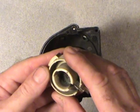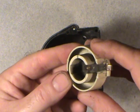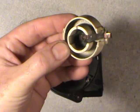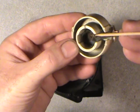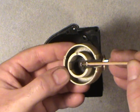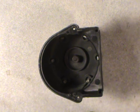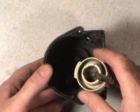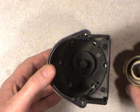It can actually get worn right through. This one went a bit too far. Right in the middle there, you'll see it's supposed to be a flat piece of metal but it's eaten right through because the carbon button got too short. It's a spring-loaded carbon button inside the distributor cap. You really have to keep an eye on those if you have problems with the engine missing, not starting properly, or malfunctioning spark-wise — that'll probably be the first thing you should look at.